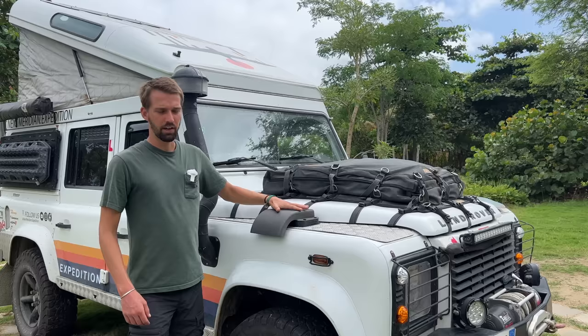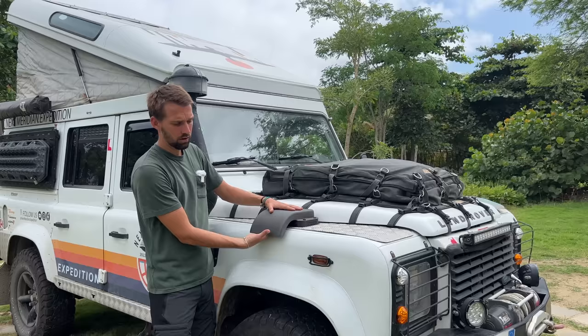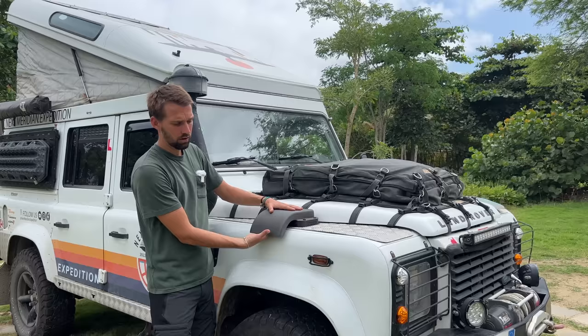This is for the AC unit. We upgraded it here with a filter. The idea is that when it rains or snows, it clogs up the air intake. This system makes the air intake come from below. And secondly, there's a filter so that when you're turning on the AC on dusty roads, you're not getting blown with dust.